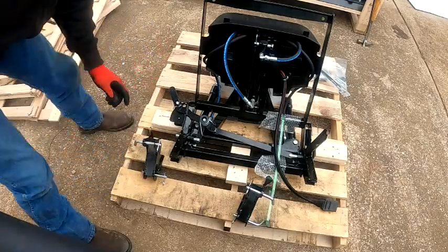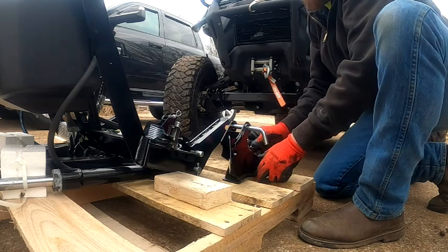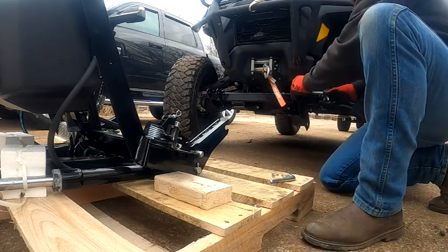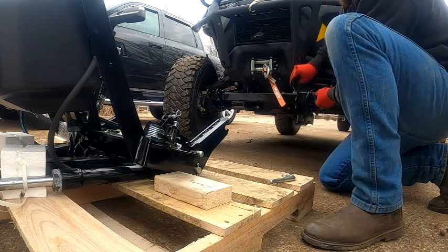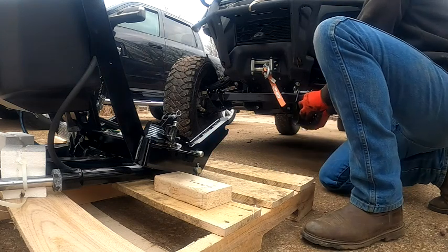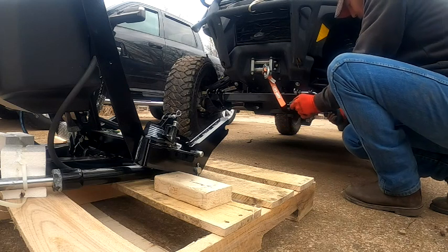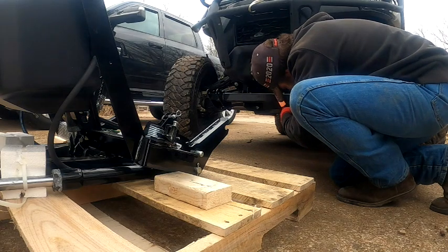And then once they're removed, we're going to remove the hitch pins. And there they are, left and right, so make sure you don't get them confused. The nice thing about this plow setup is these are removable out of season. So, clip that one in, swing it up on the inside. The rear one, when it's new, is a bit of a tight fit. I'm sure once the paint wears off, that'll be a little easier to get in.